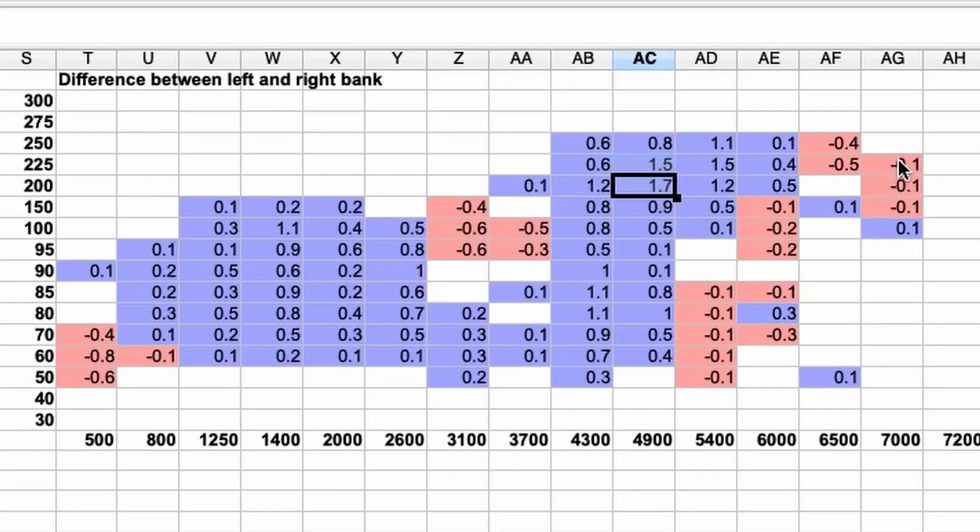I haven't dug into every moment of that log — there are tip-ins, decels, all kinds of interesting driving going on. But I did think it was cool that up at 7,000 RPM we're looking at 0.1% difference between left and right banks. So the sanity check holds true — your banks should not be off like that other car. Hope this helps you guys realize, here's a real use case with real data from a customer's car, showing you just how important it is to check both banks of cylinders so you don't torch your motor inadvertently.